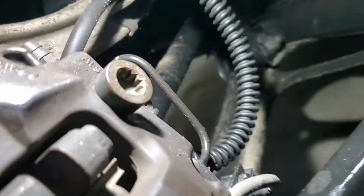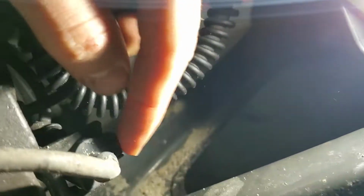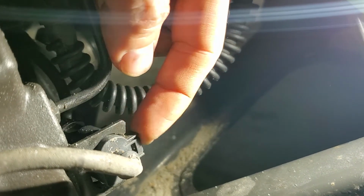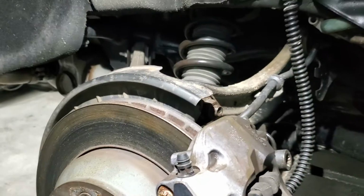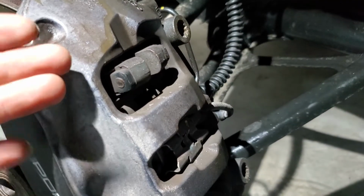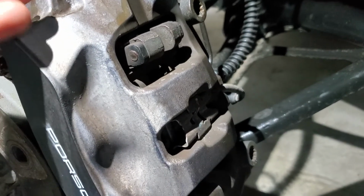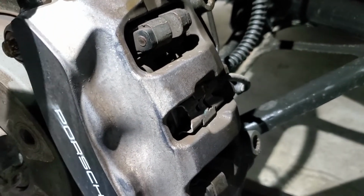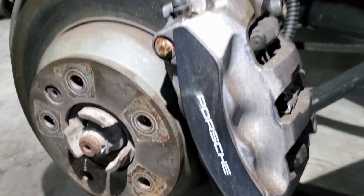Let me show you. On these plugs right here, they like to stick a screwdriver and pry on it to disconnect these plugs. Me personally, I'm kind of against that, because whenever you have plastic plugs near components that get really hot over time, guess what happens with plastic? It gets baked, so it gets brittle, and you put any type of pressure on it, so it's going to break, and it's kind of a pain.